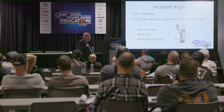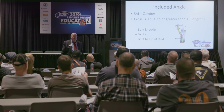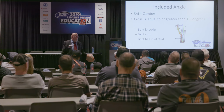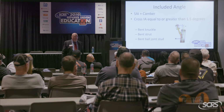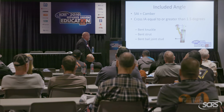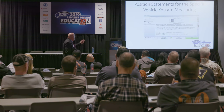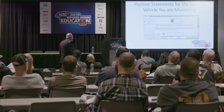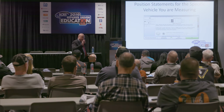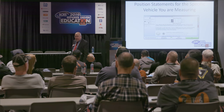Your included angle, again, it's the same deal. You're looking for 1.5 difference in included angle to go after that list of parts. All right, so this should be fairly easy to figure out, right? As long as we have numbers. Okay, so I'll put my 2014 Infiniti Q50 up, and I select it, and this is what I was talking about. This is the position statement that you're going to see right off the bat.